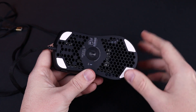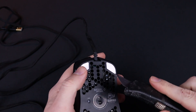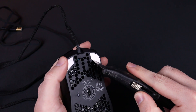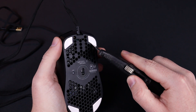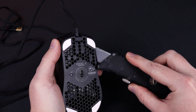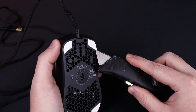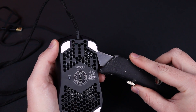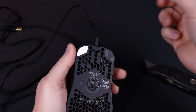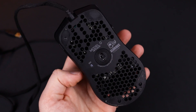Let's get into it. First we're going to have to remove the four feet. The easiest way to do this is with a scalpel — you just slice from the bottom left or right, getting underneath the edge with as little damage to the mouse as possible. Always aim the knife away from your body so you're never pushing towards yourself to avoid getting cut. As you can see, once you get underneath there it's very easy to remove. All four removed, we just have two screws on the bottom to take out.